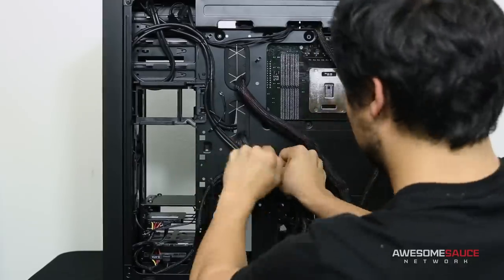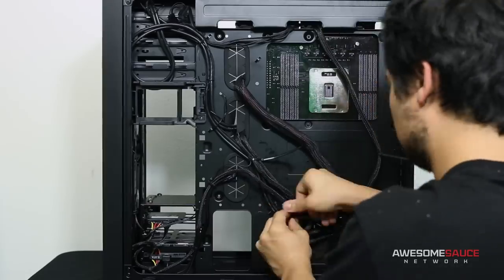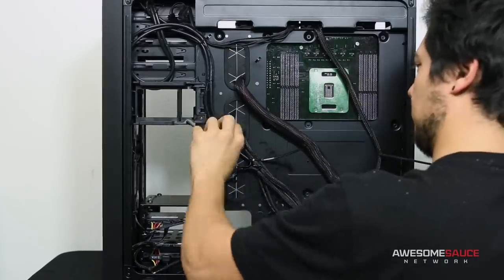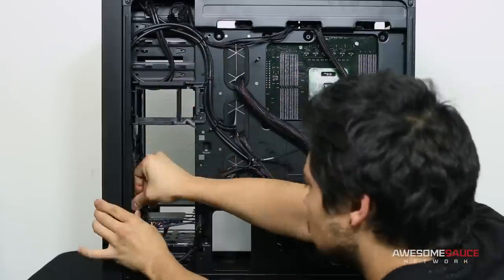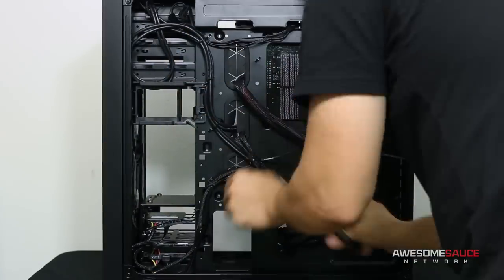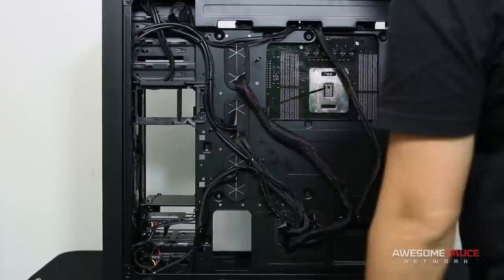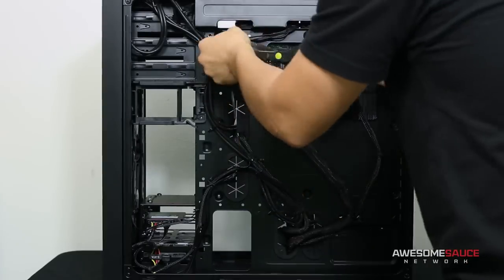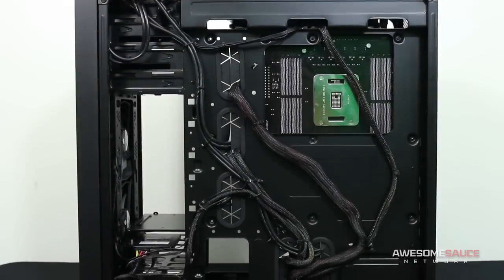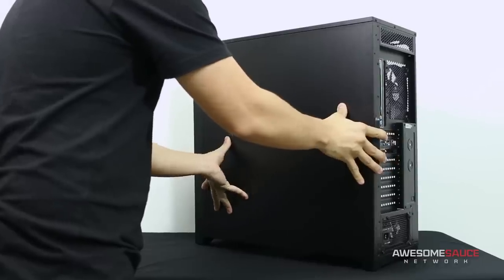Now that all the cables in your system have been connected, you can begin to tighten everything up on the back end. You'll start to see different groupings of cables forming naturally. Being conscious not to overlap any of the thicker cables, use your best judgment to decide which cables should be bunched together based on length and direction — you almost want the final image to look like a series of freeways with clear defined paths heading in different directions. Use as many zip ties as you like, but bear in mind that equates to how much work you'll make for yourself if you need to remove or replace a cable, which is why I tend to use twist ties for cables I'm more likely to remove. Follow all these steps and you'll experience one of the greatest things about building a PC: being able to fit that side panel on.